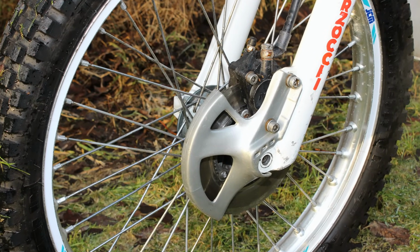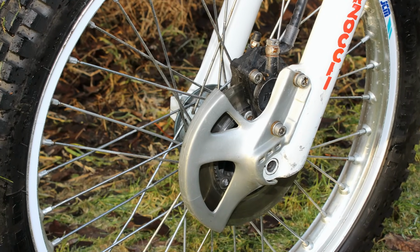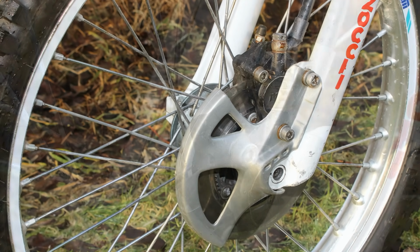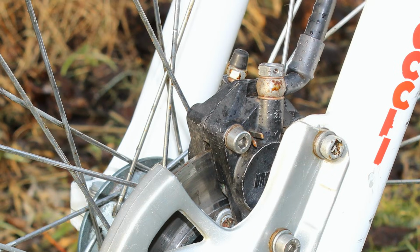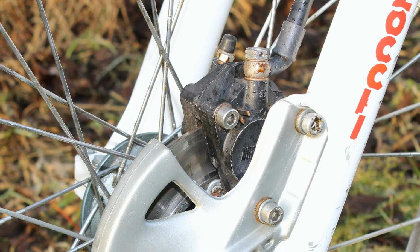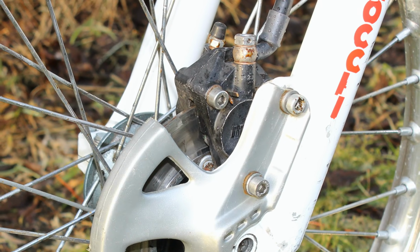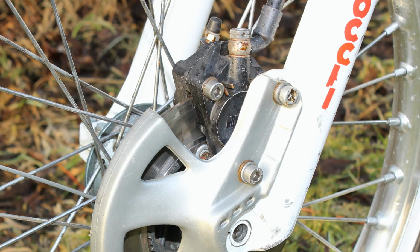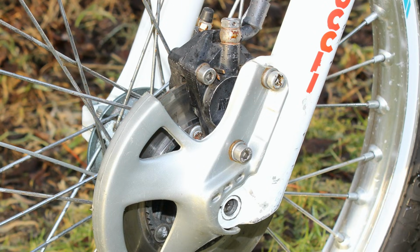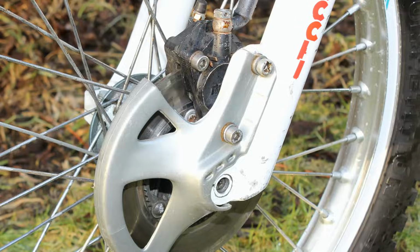And also here on the front of our JCM, we appear to have an Italian Brembo hydraulic disc brake and caliper, which again was just a single pot piston affair, but it was more than adequate to stand our JCM up on its head when it was used to kick and swing the back of the bike around into a position to tackle an obstacle. So this single piston hydraulic unit did work extremely well, because the 240 JCM was a compact and super light two-wheeled little flicker.